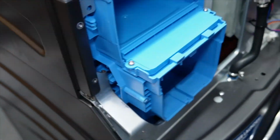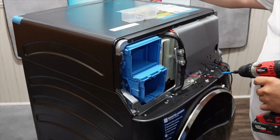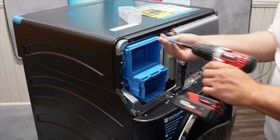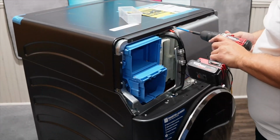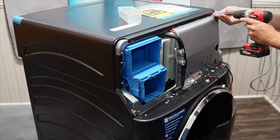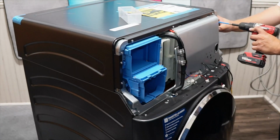The entire top of this assembly should be totally flush, and as you can see here, the lines are perfect, and if it's off center and there's any gaps, you may want to reseat the top of the unit. Next, insert the 7 screws that go around the top of the unit into place as you see here. 2 on the left side, 3 up top, and 2 on the right. Note the super wide screw that gets installed on the right side of the assembly. This is very important that you install it because of the interface that we're going to put on soon.